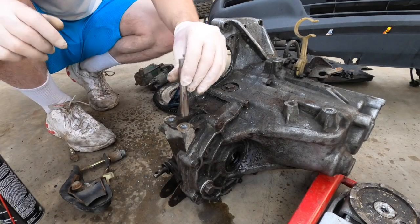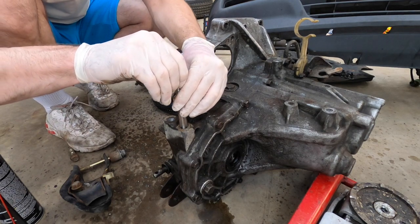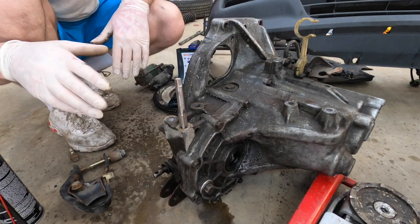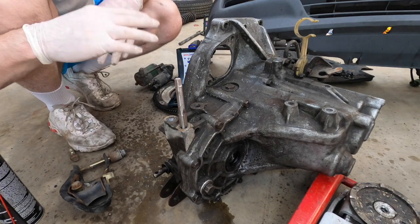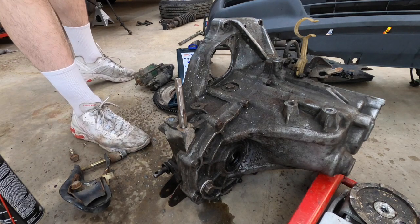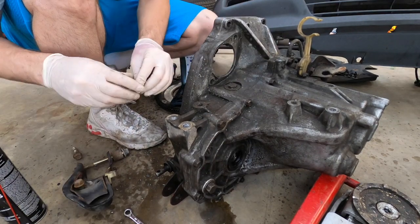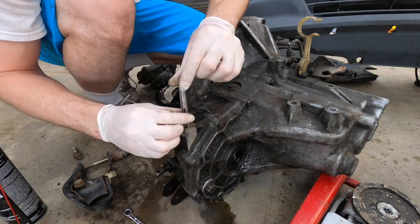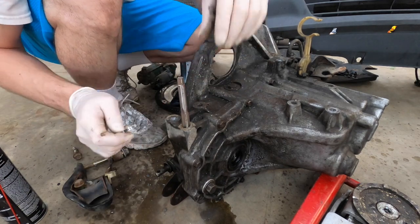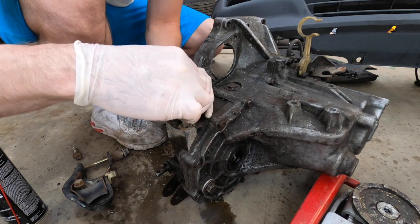All right, we have our tap. Basically, you want to get it as straight as possible, and then with a ratchet or something, slowly start to twist it down in. Make sure it's straight, and then go until it kind of gets snug. That's when it threads, so stop, thread it, and then you should be good. So I need to grab a ratchet or a wrench for that, and then we can get cracking. The top part of this is a 9mm. So as long as you get it started, get it kind of straight in there, and then you should be good to just start going down.